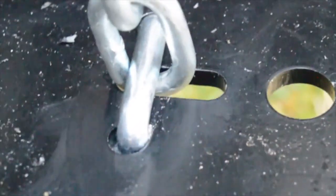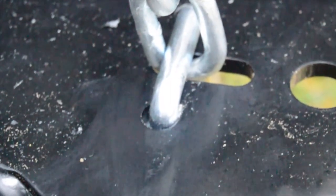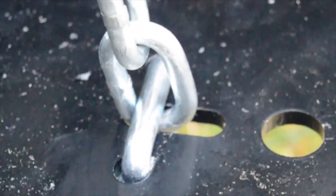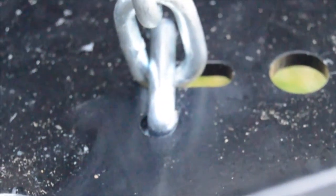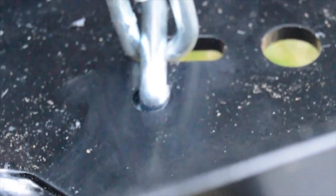So now I'm gonna have to loosen those and let everything just rattle around, and I understand that you want the chain to be loose, but my U-bolt's gonna have to be loose too, which means I'm now gonna wear the threads out and start to create stress risers and weak points on that U-bolt. And I'm not sure if Snowbear did that on purpose. I can't imagine a reason why you would want the actual U-bolt there loose. I understand wanting the chain loose so it doesn't bind, but I have no idea why you would want the U-bolt to be loose and not snugged up to the lower A-frame. And, I don't know, they look like they're drilled 12 and a half millimeters, half an inch, too far forward.